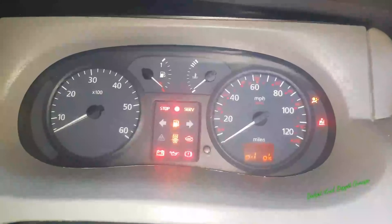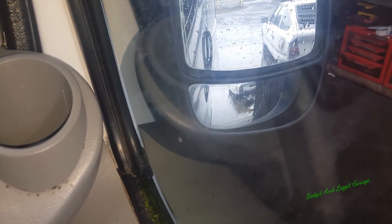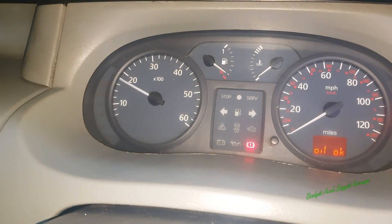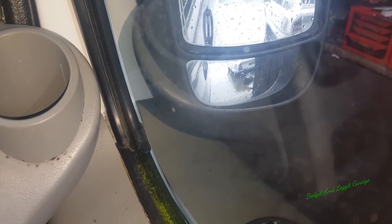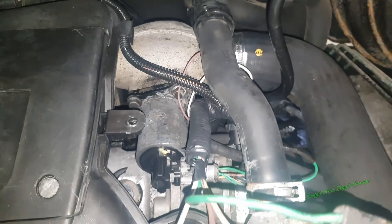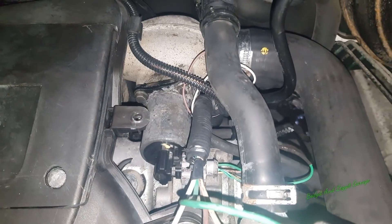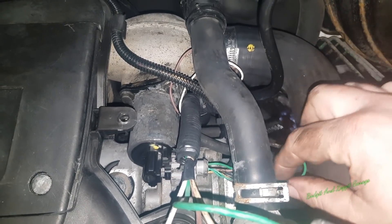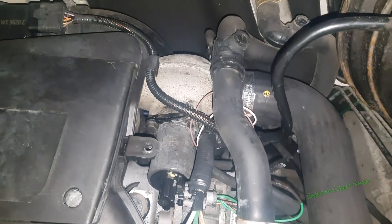So let's start it and give it a bit of a rev. Yeah, it's still not great — it's spluttering as it's going up and we've still got a bit of smoke coming out. But it is better, which is good. We're still getting that gunk splicking out and that was completely clean before. So I'm going to clean it, tidy up all these wires, and see what it does. I'll take the EGR valve out, clean it, put it back in, and then we'll finish off the video. I've done videos on how to clean EGR valves — with a sonic cleaner, before and after — so there's no point going into all that again.